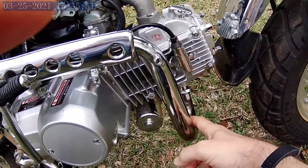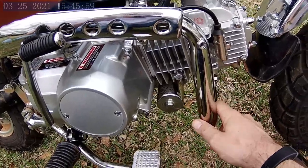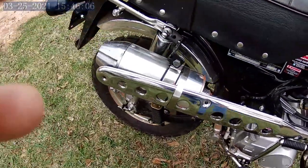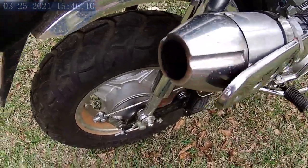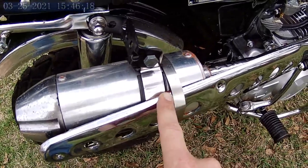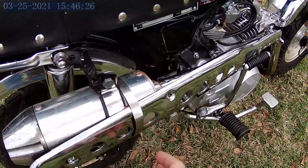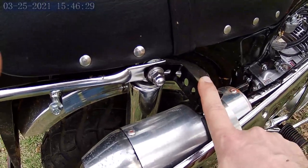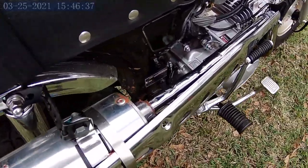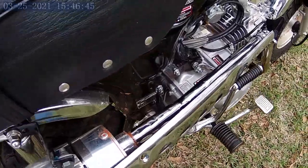Moving on to this cheap pit bike exhaust off Amazon or eBay — very cheap, about $40, not great quality, but a lot bigger pipe diameter from the mouth all the way through. It does flow well and sounds good. I used a stock heat shield with a four-inch hose clamp, and I used copper RTV on the back side to space it so there's no metal-to-metal contact so the exhaust doesn't transfer heat. It's a piece of exhaust bracket material from the parts store — I fabricated it with a vise. I had to do some bending on the exhaust to get it to fit, so it's a bit creased, but it works.